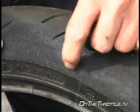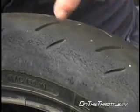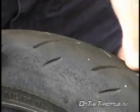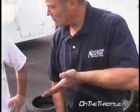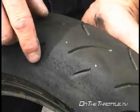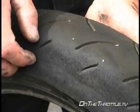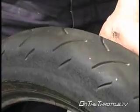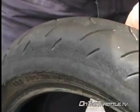This tear is caused by the front end being too soft, the back end being too high. So when it goes into the corner, it plows or stalls and then goes once the weight goes back away from the front wheel. So a geometry tear. The entire time it's up in the air, it's causing this tear. Yeah, the back is forcing all the weight onto the front tire. The front tire collapses, the sidewall goes, and you've got this wear pattern where it shows the front tire is physically sliding on the ground.